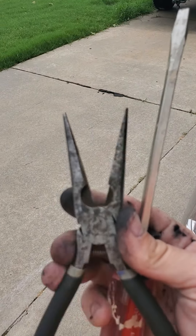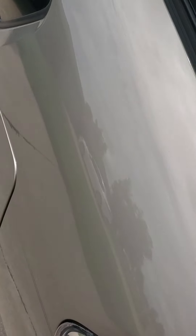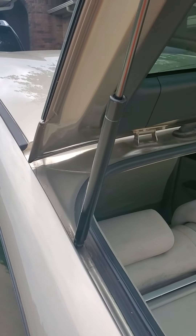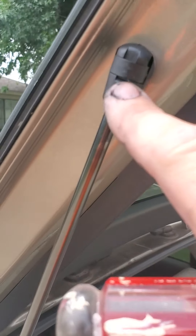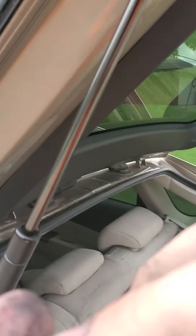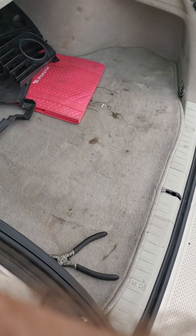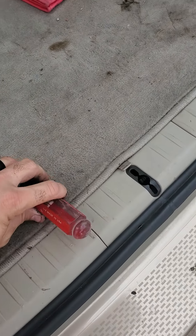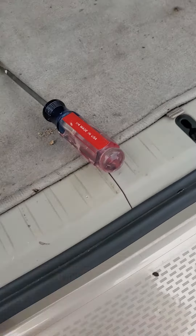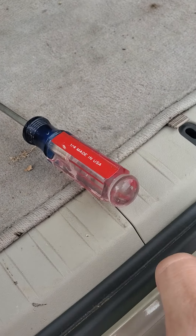You can use a needle nose or a flat head. It is as simple as — I'd want to say one two three, but I don't know how many steps there actually are. Right here is a metal retaining clip — it is like a C shape — and we'll use the head of the screwdriver. That C-shaped metal clip holds onto this ball like that, so you need to get that metal clip either pulled up or pulled out.